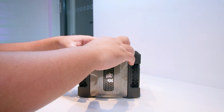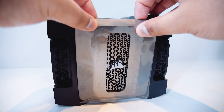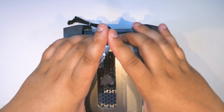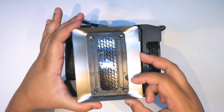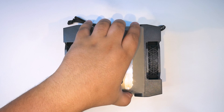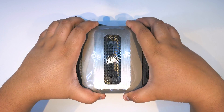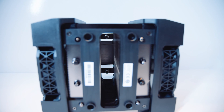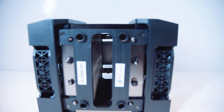The first step to installation is removing the top plate — you can grab it from the top or bottom with two hands. You need to remove it before you start installing because there are two spring-loaded retention screws that screw into the retention system underneath it. You'll need the long screwdriver to fasten those, so removing the top plate is required. And yes, you do need a very long screwdriver for this — Corsair actually includes one in the box.